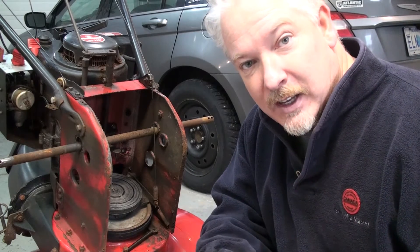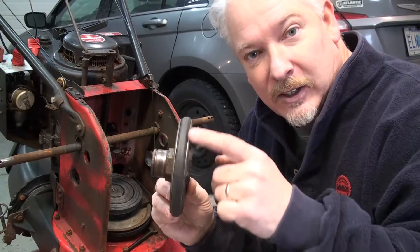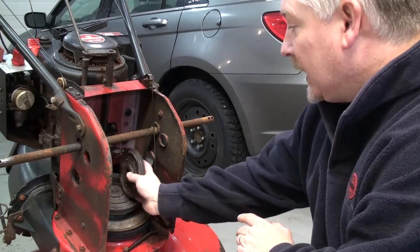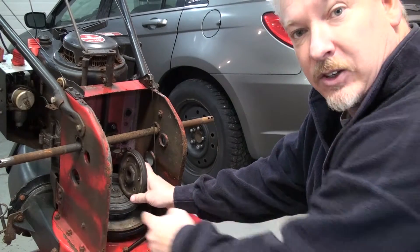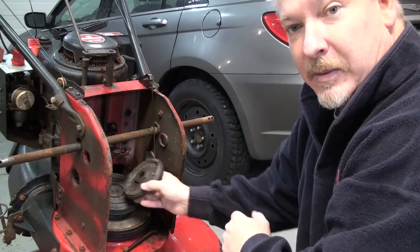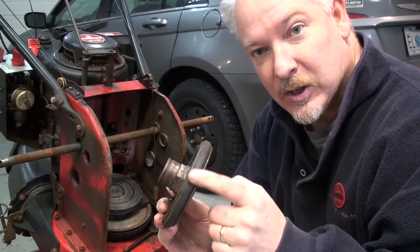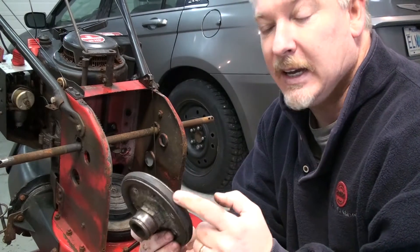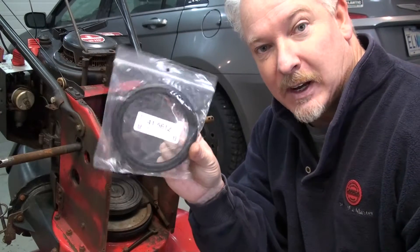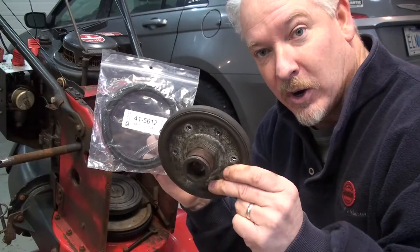Udizzy mentioned, check out your little drive wheel — the little friction wheel that goes against this surface that you see right here — and has an axle that runs through, goes on to this gear. I said yeah, I'll take that apart. And there it was — it's all worn down, as you can see. I've got a brand new one. Literally cost me 10 bucks and it was delivered to my door. For 10 bucks, I'm going to get this puppy going.